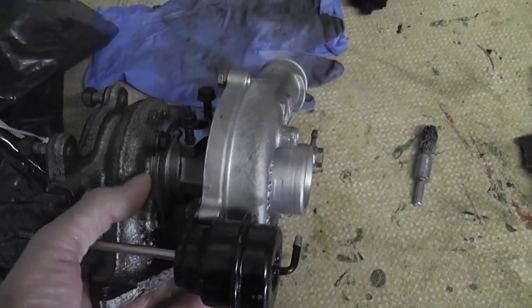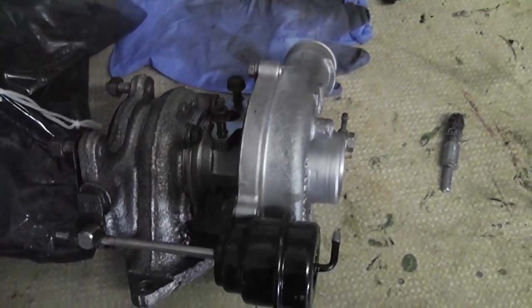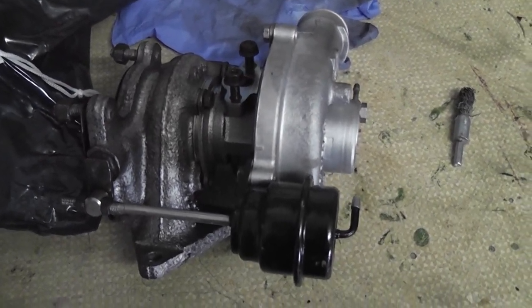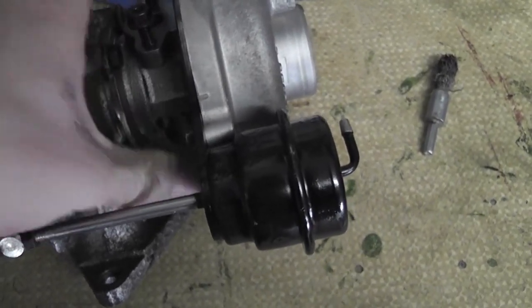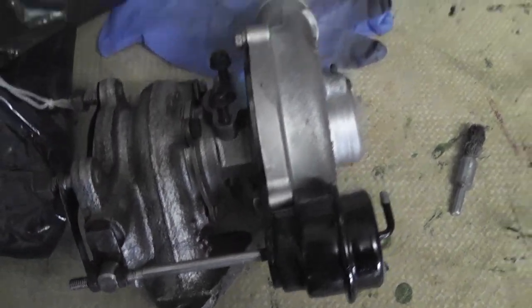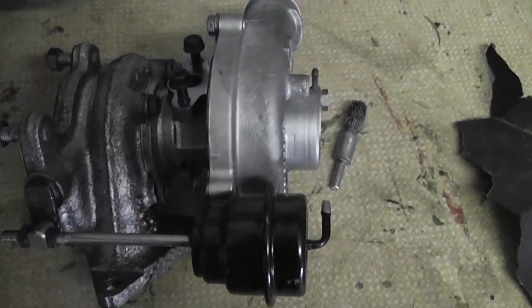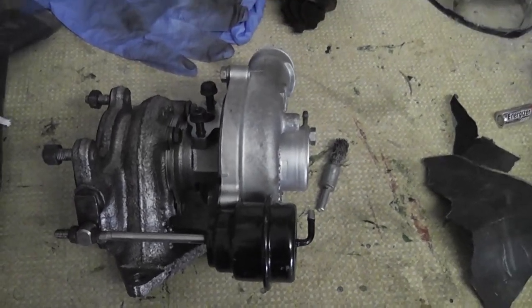The only thing is that what you can do is just leave those bolts loose on either side, and that will allow you to re-index it to suit the engine that you're putting it back onto. So that's the only thing. I will loosen them off, and there's also a bolt missing down there, which I'm aware of, so I will put that back in too, and then we'll torque everything up and make sure it's 100%. But it went together without incident. I was able to clean it up, as you see, as well. So the next thing really is to test it.